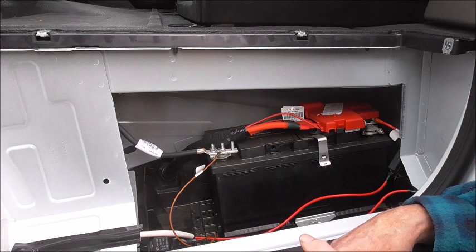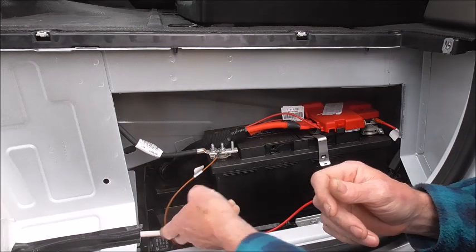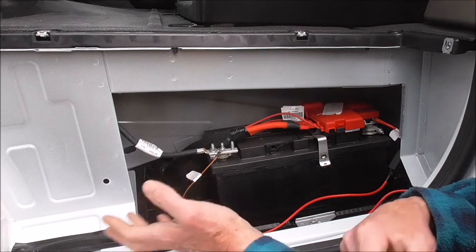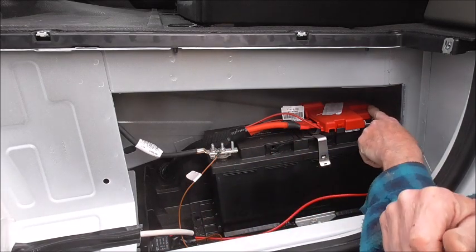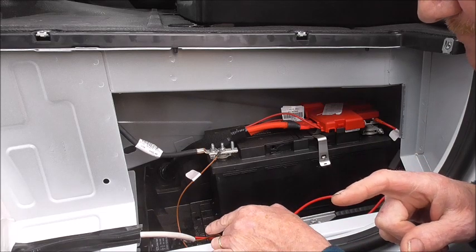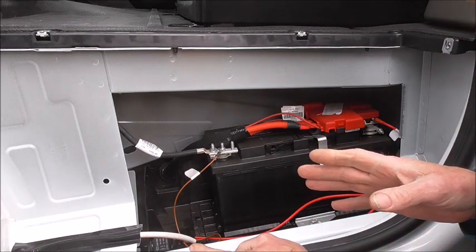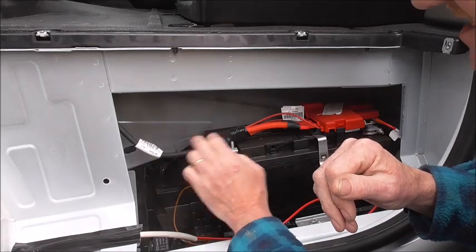Setting up the auxiliary charge system — we start off at the vehicle battery. First thing we need to do is put in a split charge relay, that is this thing down here. What this does is connect the two batteries when the engine is running and disconnect them when the engine is stopped. If you don't do that, over time you can drain your vehicle battery. You need your main cable coming from the live of the battery going to the relay, then from the relay going to your auxiliary battery. Then a switching wire to the relay, which you take from any point that comes live only when the ignition is on — the ideal item for that is usually a cigarette lighter. Check it works, then use that. The relay itself needs a ground, so I've connected that to the battery earth.